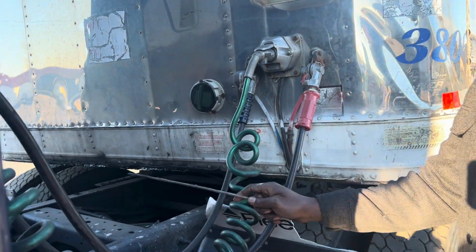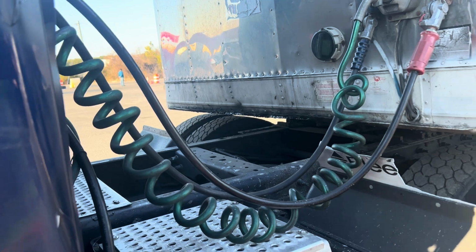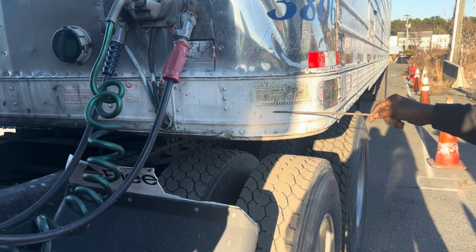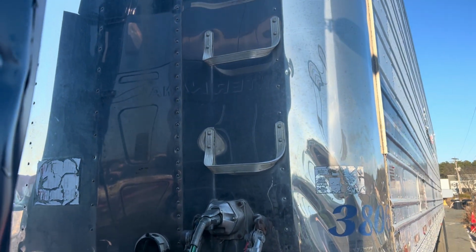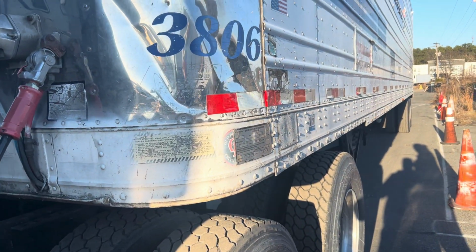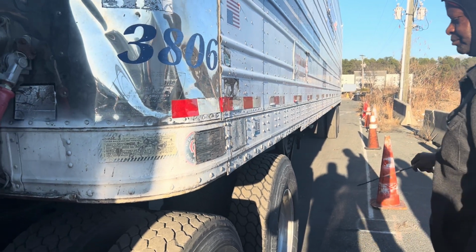Then I'll check the frame of the tractor, frame of the trailer, on all the 4 sides, all the 4 frames of the trailer. Mounted and secured to the vehicle, not been broken or cracked. It's not damaged. I detect no illegal welds on it. This is the header board, but we don't check it anymore. Then I'll check my DOT tape all the way down the trailer, mounted and secured to the vehicle, not been broken or cracked.